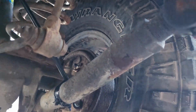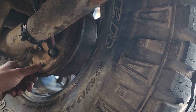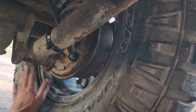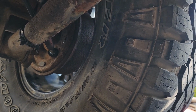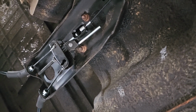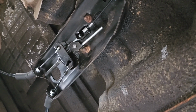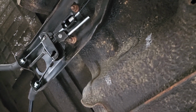And when I adjusted the brakes too, I adjusted the little wheel and I spun it as hard as I could. And I adjusted it until I got one full rotation on the wheel before it came to a stop on itself. So I know the pads are adjusted properly before I even adjusted this. So yeah, if you're looking for your TJ to be able to hold itself on a 45 degree incline with nose pointing up the hill, it's not going to happen. It just will not happen.